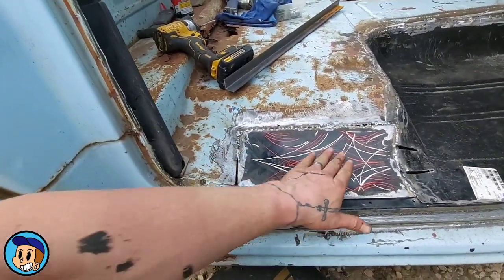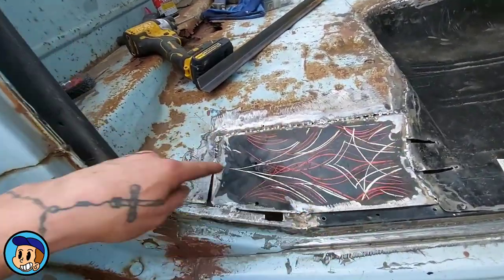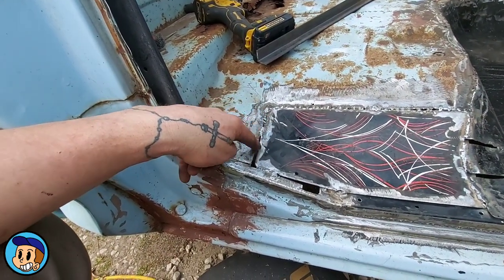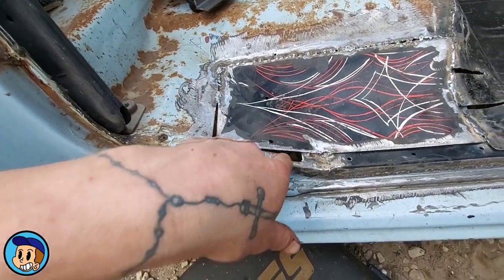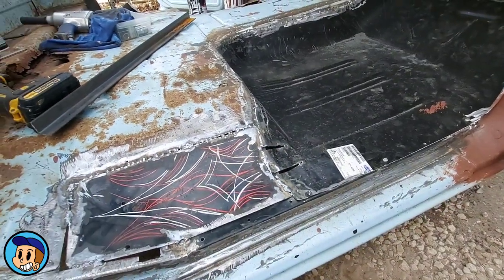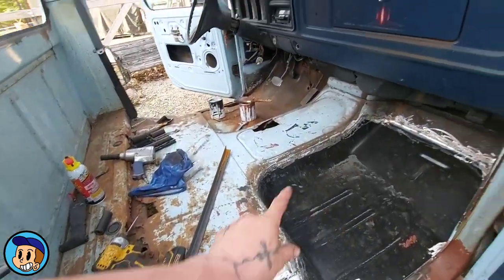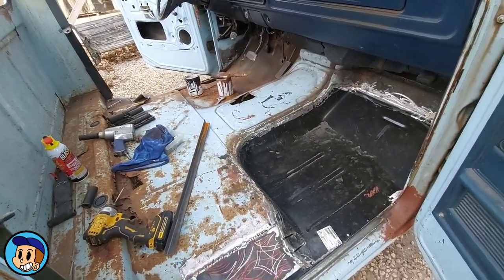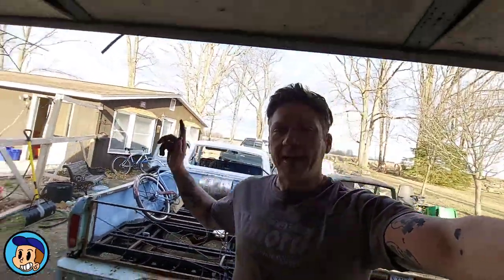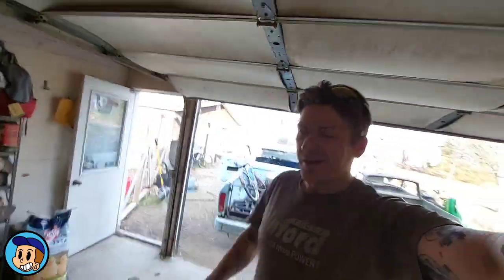And as I bent it and worked it into shape and hammered it down, I lost a little bit of metal right here. So I gotta do some makeup there, and I gotta cut this little piece right here. Some little filler pieces where I had to let some relief cuts in. Little tack welds I gotta go through, and a bajillion more of those and knock them down. And then I'll come through here with probably some sealer. More particularly on the bottom, I'll probably hit it with a nice heavy sealer, as well as rust-inhibiting paint. And it'll probably get some sort of rubberized coating on the bottom of it.